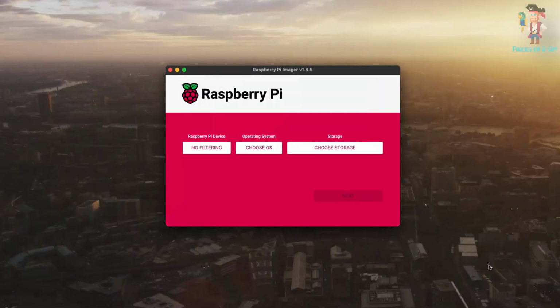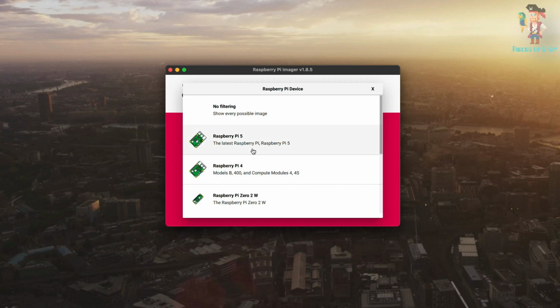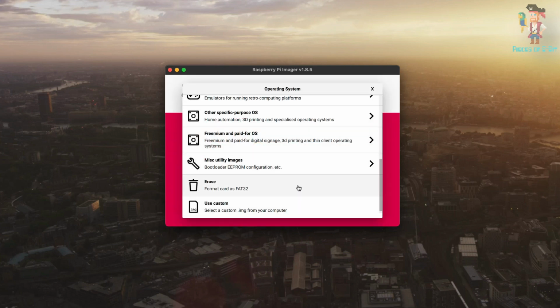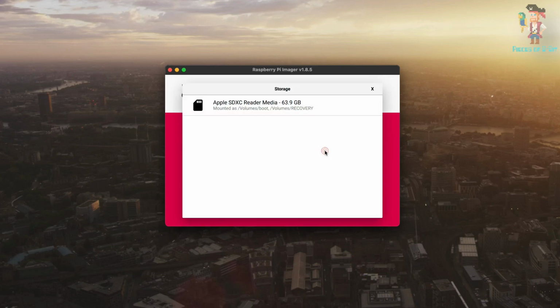Okay, so we're going to have a look at getting our SD card set up for our Raspberry Pi device. So ultimately, there is really now only one tool that I think you need, and that is called Raspberry Pi Imager. You can get it from the Raspberry Pi site. I will put a link in the description. And what you're going to do in here is, first, pick your Raspberry Pi device, and we're going to do an erase of our card first, and we're going to pick the SD card itself.